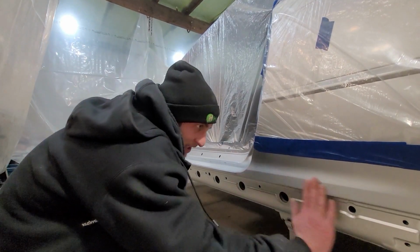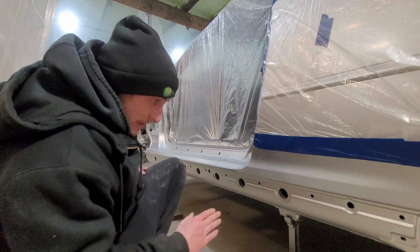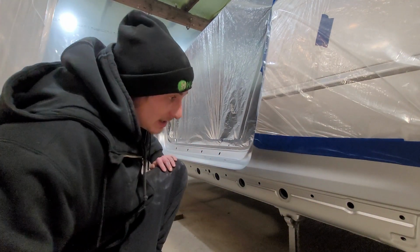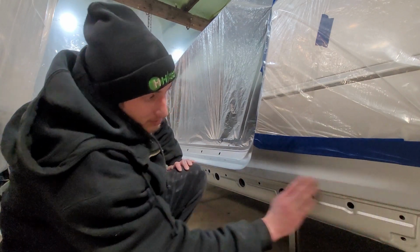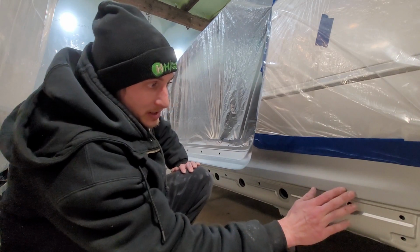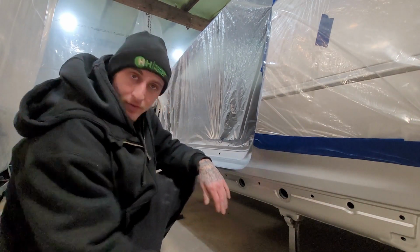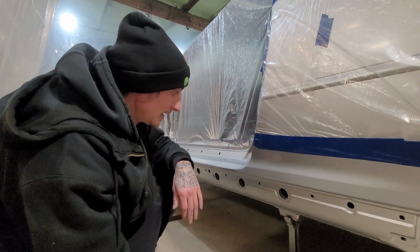So my overspray here, I ran into an issue with. I stopped filming because I honestly thought that I had messed this entire thing up, and eventually I was able to sand my way back through the overspray down to the original paint, down to the clear coat, not through the clear coat. And I used 400 to get down to it and cleaned it up with 1500.